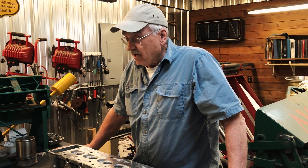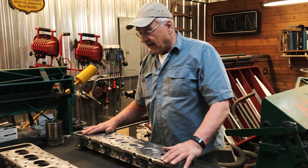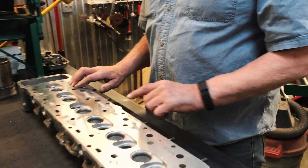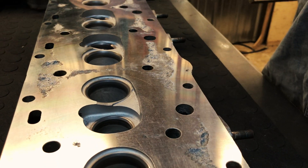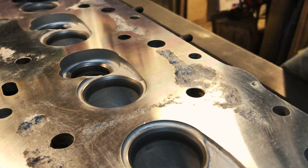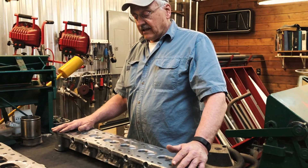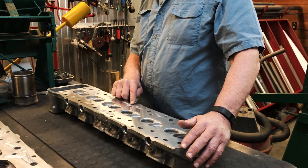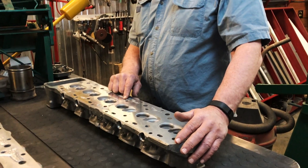Now, some issues beyond basic design. You can see that on the bottom of the cylinder head we have some pitting. The pitting is a problem as far as structural integrity is concerned. This particular cylinder head is going onto the Texas XJS — we're doing a budget rebuild on it. You can see these pits are in the neighborhood of about one eighth of an inch deep, which could be a long-term problem if it progresses further.